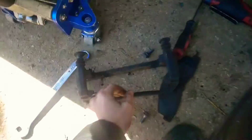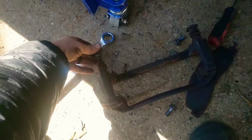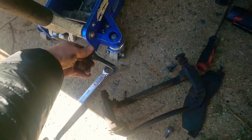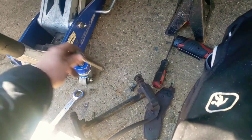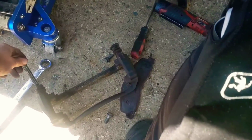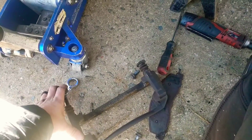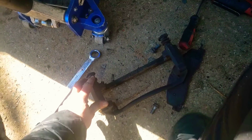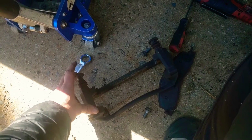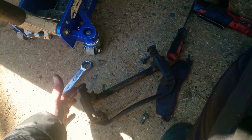And the other thing, when you're putting everything back together, these slide pins, okay? This one is probably not that important because it's the first brake job and they still slide really good, but you get your little can of grease, dip it in there, and then just kind of stick it back in the hole, snap it in. It'll kind of click on the little thing. You just hold that rubber boot and pull out to get the slide pin out. But anyways, just make sure you grease those slide pins, because that's a lot of times why they'll wear unevenly, is because one of the slide pins gets stuck.